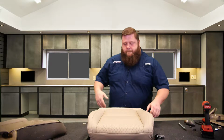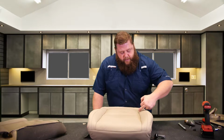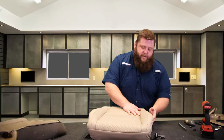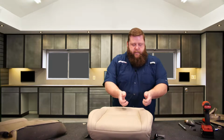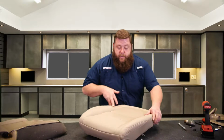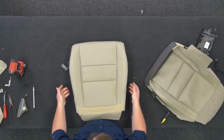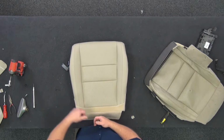If you had some different ripples in the foam or in the top cover, if there's lines going this way or that way, that means you may have one part too far forward, like this Velcro. You might not have stretched it enough pulling it back when you hook it on. And then when this piece wraps around and clips, it's too far forward, because if you take a piece of material and move one side forward, one side back, you're going to get ripple lines in it, okay? So if you see that, you may look and see if it's something you can roll the edge and massage out and pull it and smooth it. Or you may have to unclip it, come back, set your Velcro again, so move it forward.